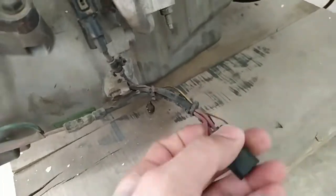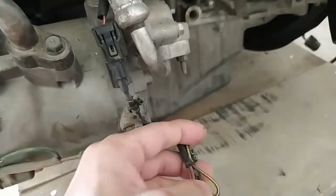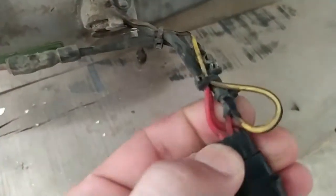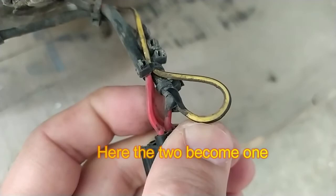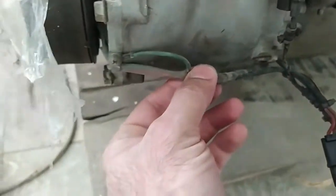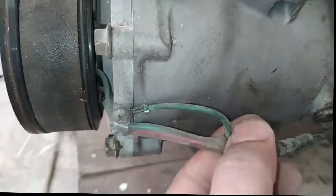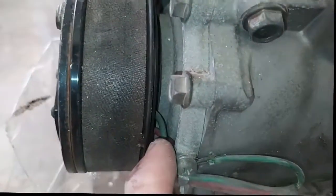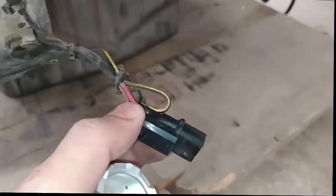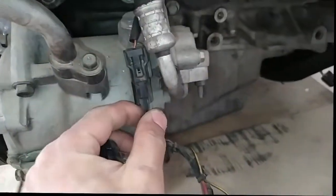Because the engine load is high. This is your button which you push inside the car, and this is going into this red wire. This green wire is already ground — ground is already there with the nut or screw. Just this red wire is the trigger, that triggers this relay and this clutch. This is coming either from your ECU or from your inside AC compressor button.